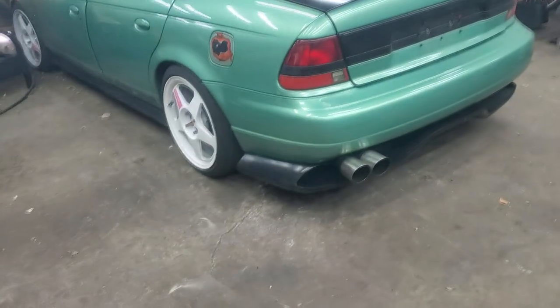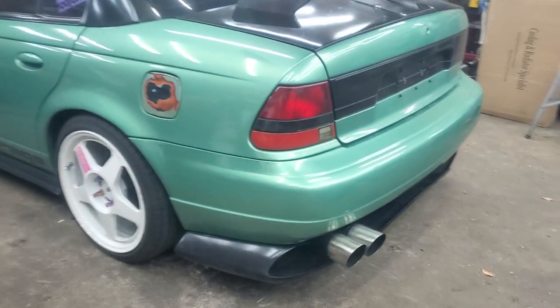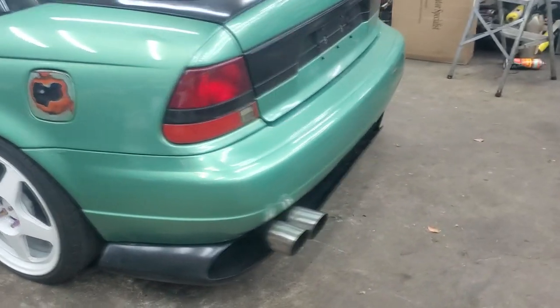Car's back on the ground, everything's put away, and the fitment is perfect — exactly how I wanted it. It looks pretty cool. However, the sound is raspy as hell. I don't understand why, because when it was open downpipe with two and a half inch in the middle of the car it was deep and sounded really good. Now there's just a piece of pipe between that and the tip and it sounds raspy. I'm thinking it might be because I'm routing it through a two inch pipe.